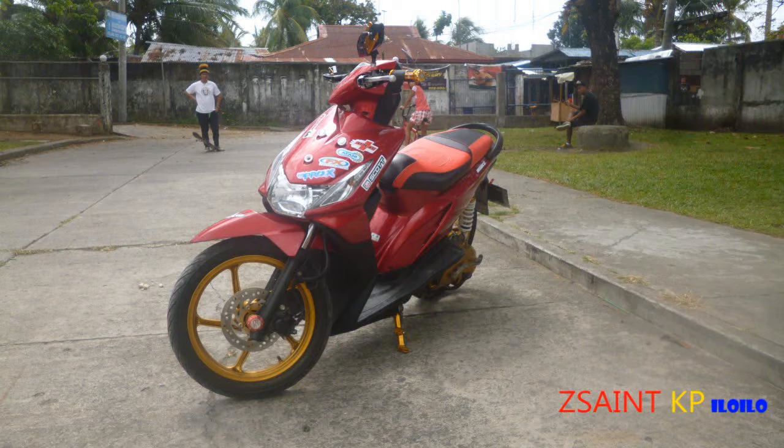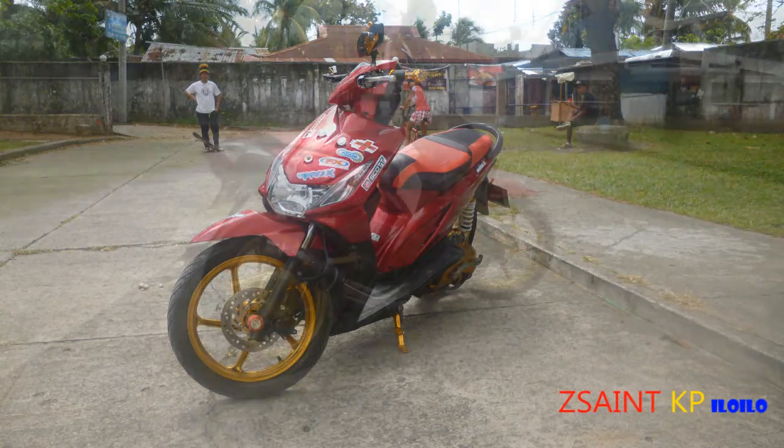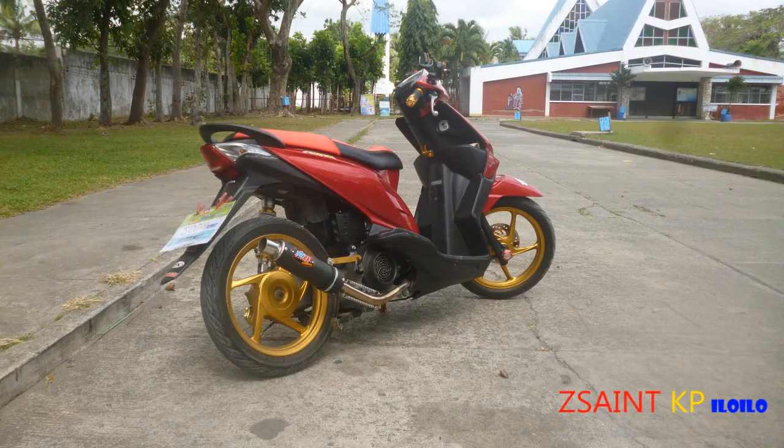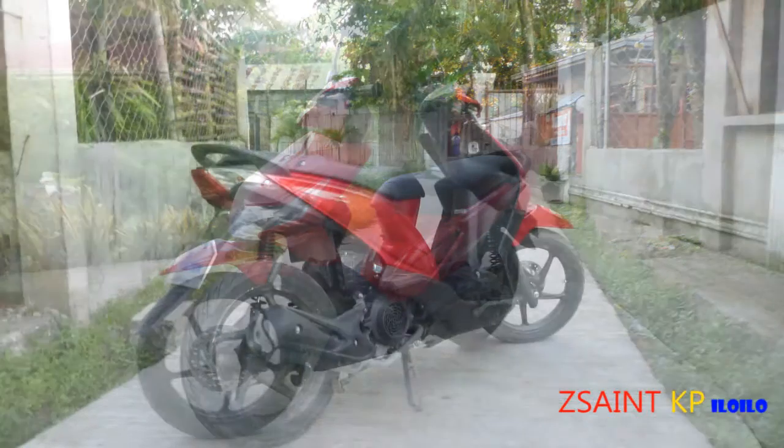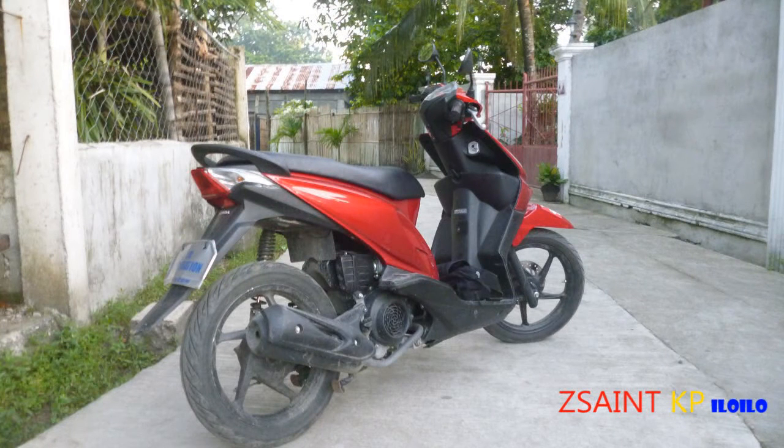This scooter at that time featured V-TACS. This was a small valve in the exhaust port that was operated to close and activate by a lever via the rider's left heel. And this scooter featured a 12-volt electric start and CVT transmission. The transmission changed from low to high at around 5,500 RPM.